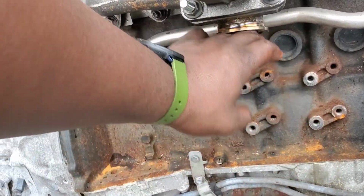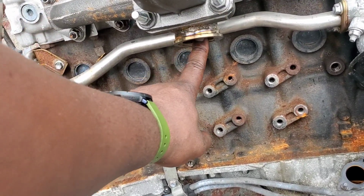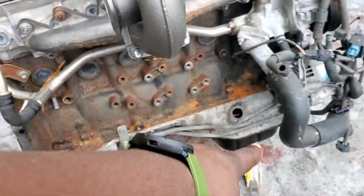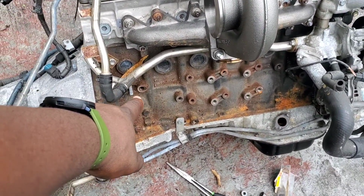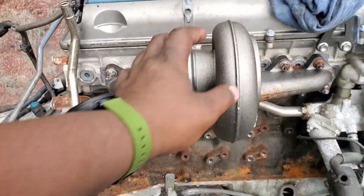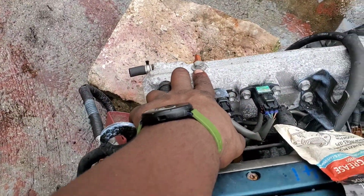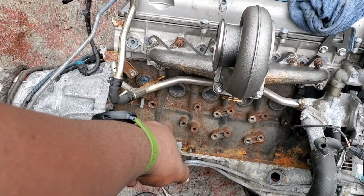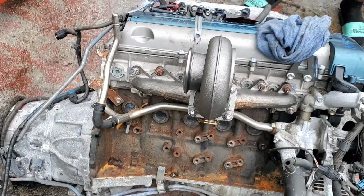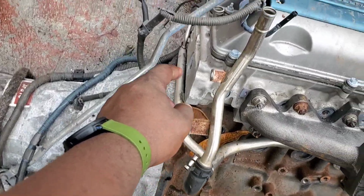Now what I'm gonna do, I'm gonna find that wastegate. I'm gonna put like a 10 PSI spring inside this wastegate. It's a Tial 44 millimeter, and then I'm gonna put it on here. And then start doing these drain fittings, bung one of these for the feed and make some stuff work. You see the one for the back one right here, what I love to use on the 2JZ engine is this one, to bung it up along with a good amount of thread tape, and then use the front one to feed the turbo.